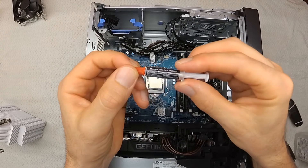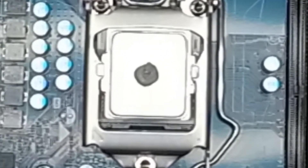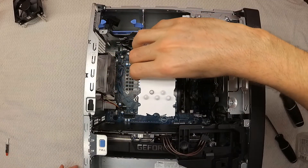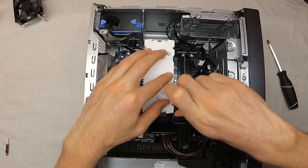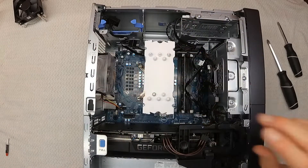With our surfaces prepped, it's time to put down some thermal paste. A pea-sized blob in the middle of the CPU should be all that you need — there's enough paste for two applications in the supply tube. We can finally install the heat sink. Carefully place it directly over the CPU and line up the mounting screws with the motherboard. Use a screwdriver to tighten the four screws in a criss-cross pattern, just tightening a little each time until you feel them bottom out on the motherboard mounts.